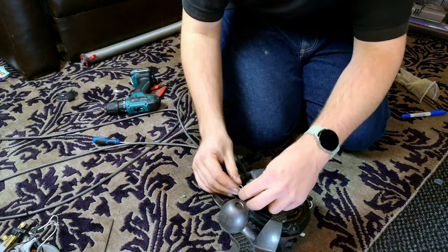The duct has to fit very squarely and properly down otherwise it leaks in hilarious ways when you've got it all back together. Put all the screws back in - that's actually the wrong screw in the wrong place, let's put this top one in to hold it. Oh, we have a trapped loom - you have to be very very careful. The brush roll switch - there we go! We didn't lose anything, that's excellent. Put all the screws back in. With the suction duct on nice and square we can fit the little spring for the wheels back into place.